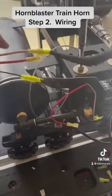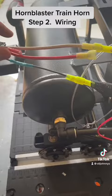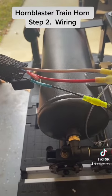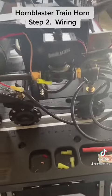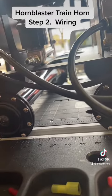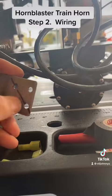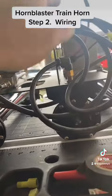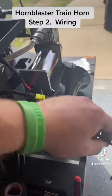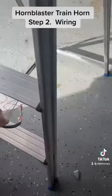What I did was I put snakeskin all over this. This white one right here goes through the compressor — this is going to be your 12-volt in. This goes to the ignition switch, so basically my switch at the front on my dash. I do have an electric drain — I popped it right here and put one of the couplers on, so this is going to blow out when I hit the button inside. I took this plate, made a template, drilled it through, and mounted it right there. All my grounds are T-tapped together right there — I have dielectric grease inside — and this is going to go to the frame, so it's only one thing going to the frame.